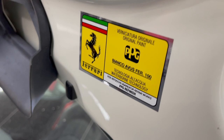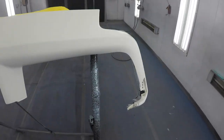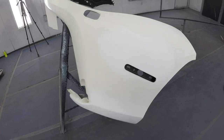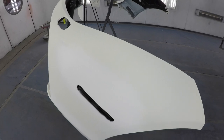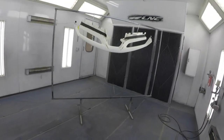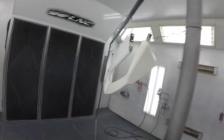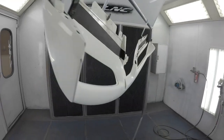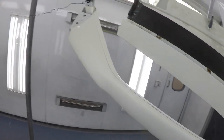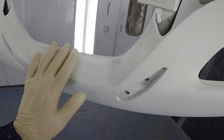I did my spray test, we got the right color. I'm only going to throw a base on the bottom of the passenger side — the front's good — and then I'm going to blend the left corner. We're going to stay away from the edge and just put base coat over the primered areas. We have this front lower section of the bumper, very intricate. We had to hang it — it needs to get paint from both sides, it's a wrap-around spoiler, so there's no other way to paint it but to hang it.